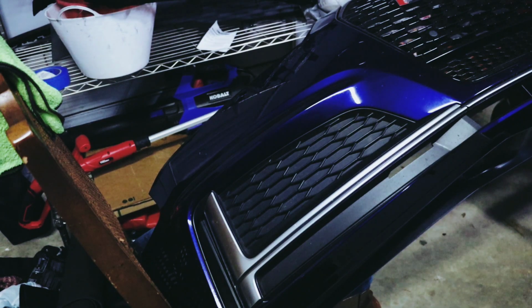After removing the plastic off of the lip kit, I'm gonna go ahead and install the little accents. Now these are sold separately. They don't come with the lip kit, so you gotta kind of piece them together. So you can match it with whichever lip kit you like. So this you will kind of have to line up to the best of your ability. So we're gonna wipe it off with water, then come back through it with alcohol, test fit it, peel it back, and stick it.